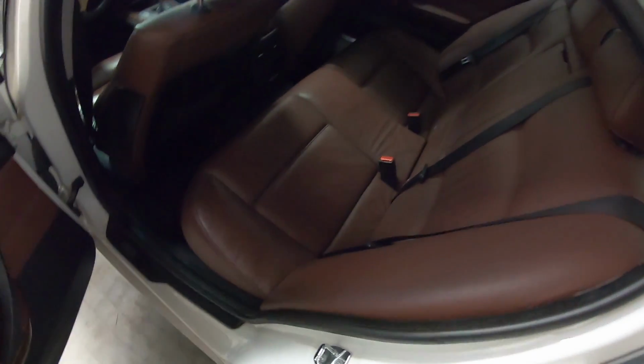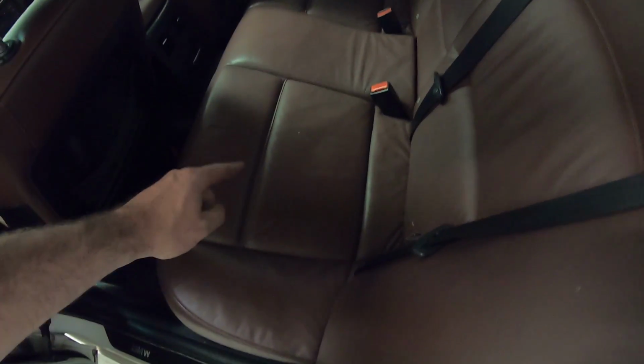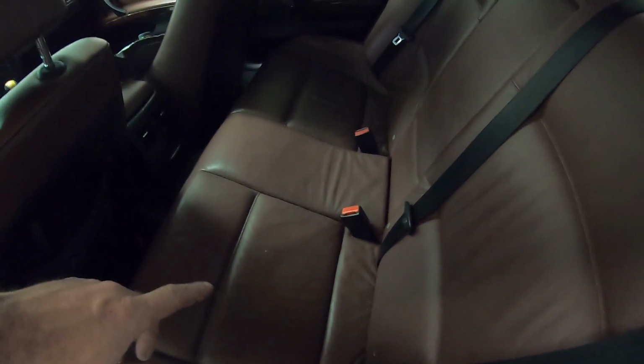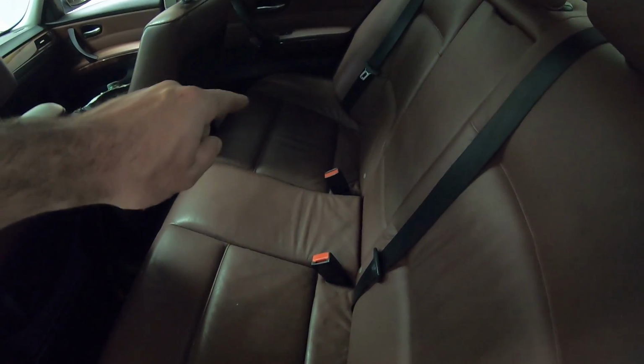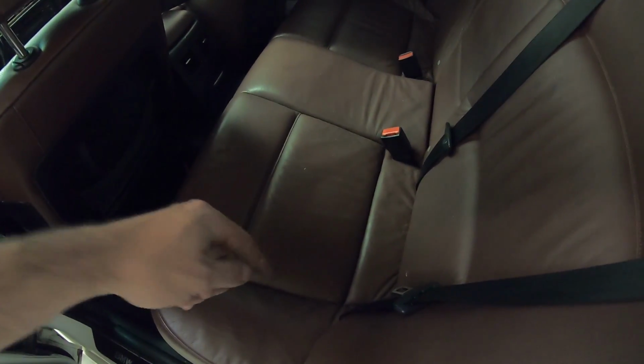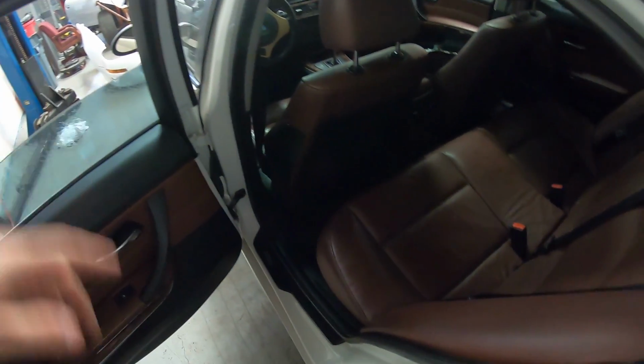In these cars, there's a sending unit under the driver's seat that has the filter and the regulator, and then on the passenger side is where the pump is. It's a saddle tank design, so there's siphons that try to get all the fuel to go to the passenger side for the pickup, sends it to the driver's side through the filter, dumps excess pressure through the siphons and pushes it back to the other side of the tank, then goes out to the front of the car, which we have hooked up right now.